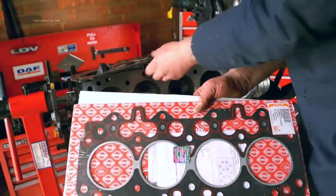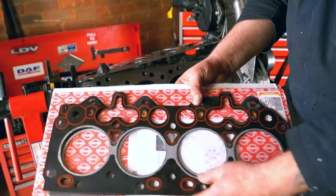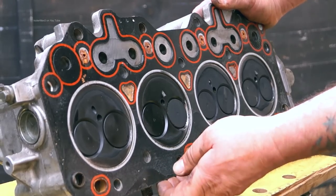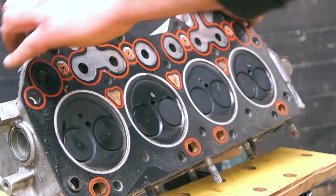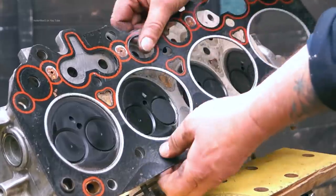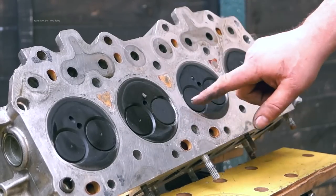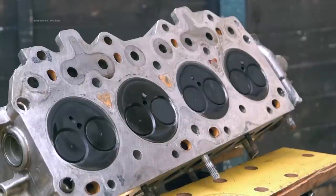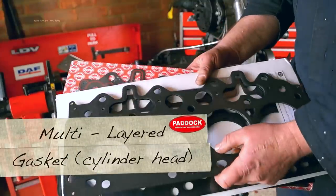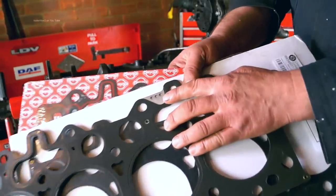Head gaskets. There are a couple of different types. This one is the composite gasket. The composite gasket is by far the most popular gasket fitted. It does leave a bit more mess on the cylinder face and the block. Links for the product are in the description below. The second type is a tin multi-layered gasket, which is an upgrade from Land Rover.